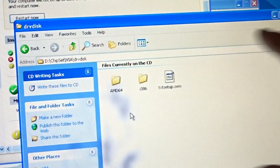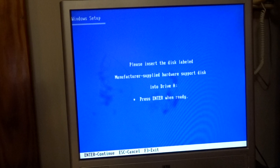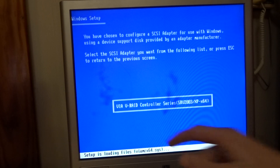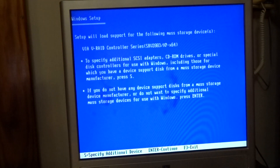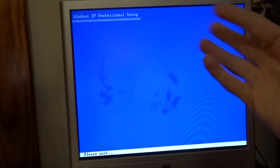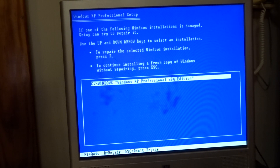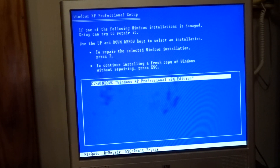Here are the results - I'll talk about these after. And it just worked. I don't get it. About the restart - I'll show you what it looks like. With the setup CD, you do this, then hit S. Put in your floppy with the copied drivers. Hit enter, then click through it, and it loads. It works. Then you hit enter, it loads a couple more things, and then we can set up Windows. See? It works - it pairs with this. Hit F8. The system is prepared so it can read it. That's all I need.